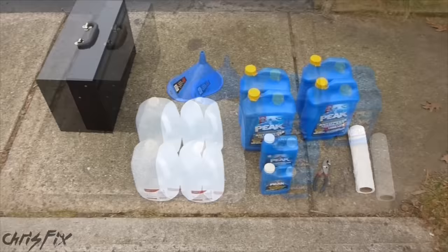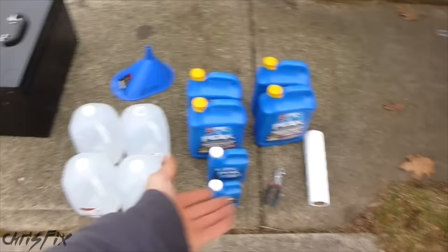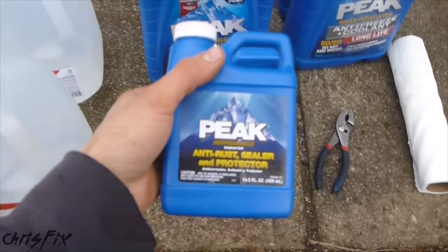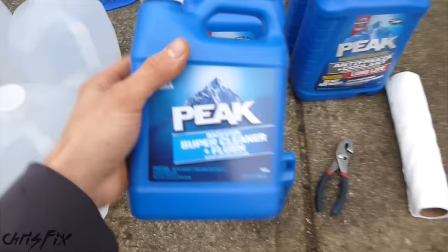As we wait for that to drain, let's check out what we're going to need to do a coolant flush. You might need some basic hand tools, so get your toolbox. We're going to be filling up with 50-50 antifreeze — make sure you check your owner's manual for the correct type. Get your paper towels and funnel. We're using distilled water to flush out the cooling system, an anti-rust sealer and protector, and a chemical flush that will help flush out the radiator even better.